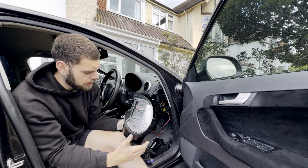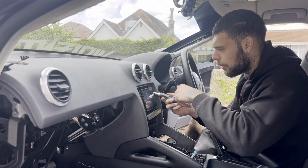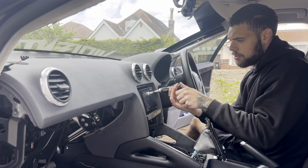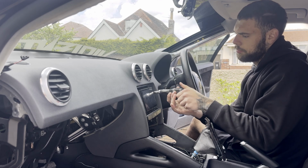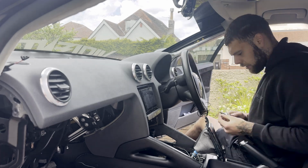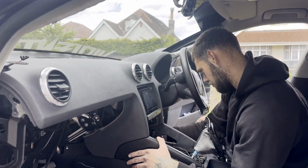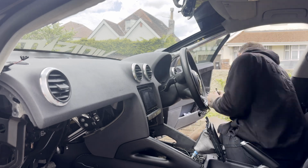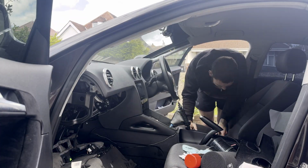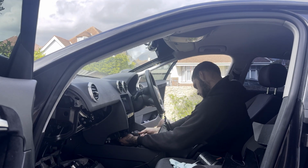One instrument cluster out. So now we've got 2 bolts in here. So I'm going to take out, these are T25s. To get these middle triangle pieces out, there's actually a 6mm Allen key right up and underneath. If you look from underneath, then you can see it, and you can get an Allen key up and under there. They're not very tight, they're just a bit of a pain to actually get the hex key in.